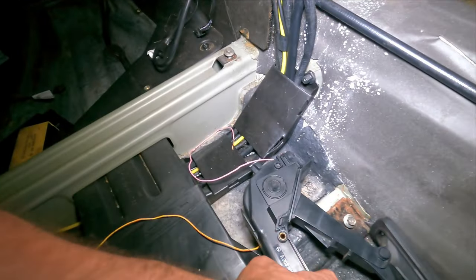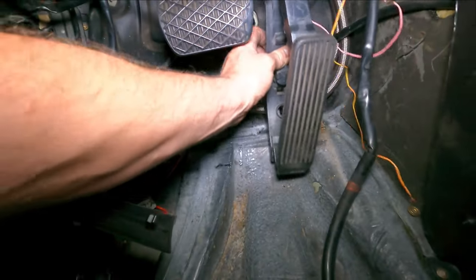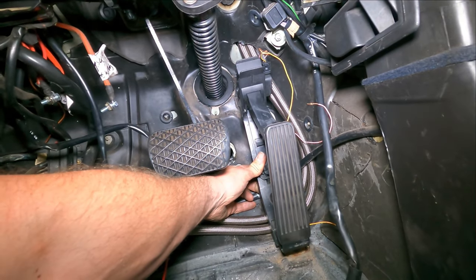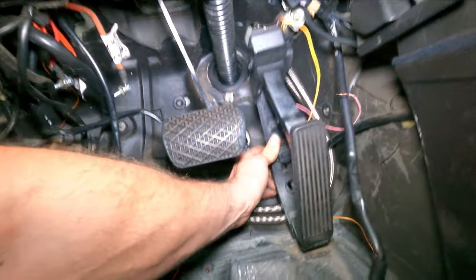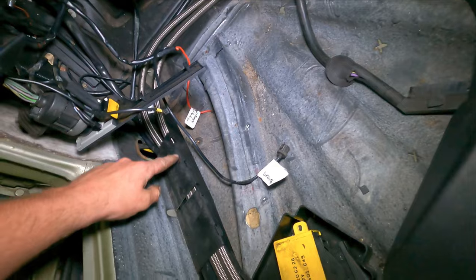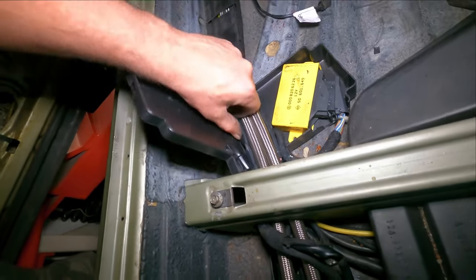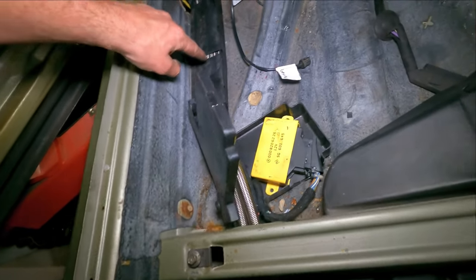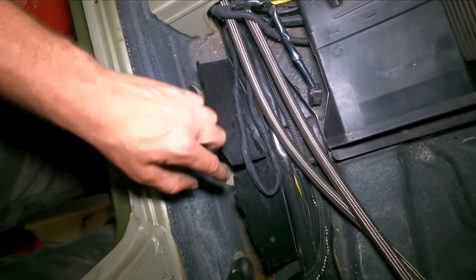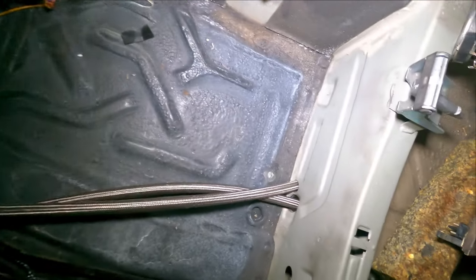The throttle pedal is an electronic one from like a C-Class or something - that will go over here in front of the fuel lines, so that is not really a problem. I have to make some kind of small frame for this. The lines are going through here where the wiring normally goes, so I need to modify a little bit because it is a little bit tight. The other two fit - in the front it will fit, and here it will fit easily. Then the hoses will go over the flat floor and then outside.